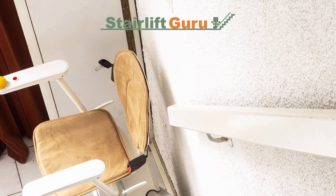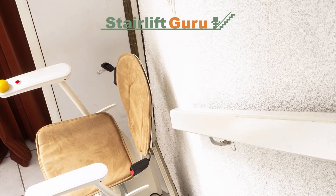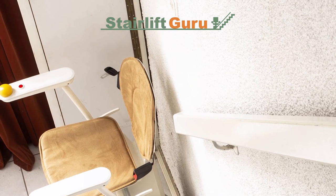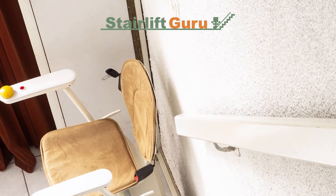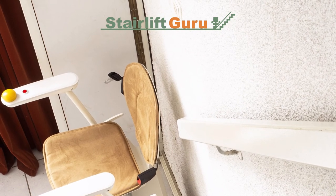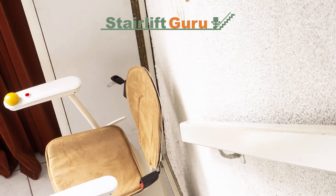Have you checked the safety switches? Your stairlift should have built-in safety switches if any major problems arise. These switches could have been turned on or put into lock mode, preventing them from moving at all. You can usually find these on the top of the carriage, on the bottom of the carriage, up and down the footplate, and on the front cover of the footplate.